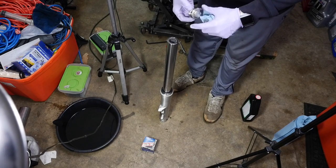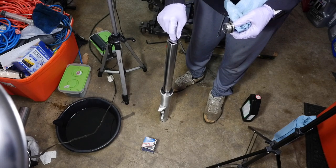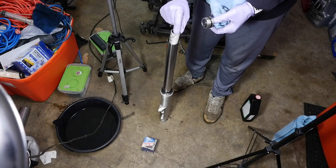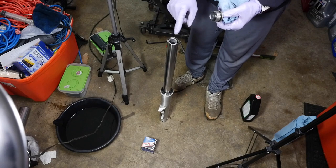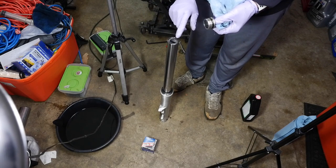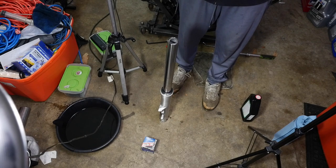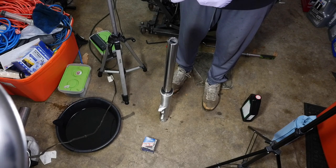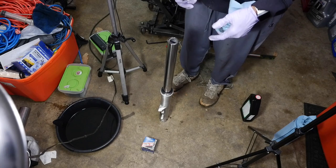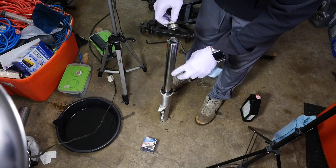The other thing with Progressive is they recommend that your spacer, which is this little piece of PVC here, can you see that? Yeah, you can see that. They recommend that the spacer plus your washer equals pretty much the top of the fork tube. I don't have an issue with that. When I got the springs, they recommended a three inch spacer, but man, it was just too rough for me. It rolled rough. I shortened it down some, and right now at 2 5/8, I feel it rides pretty good, especially over bumps, because in New York our roads aren't pretty good at all.